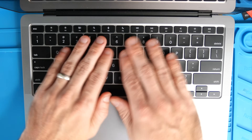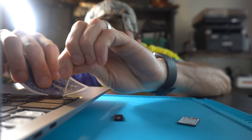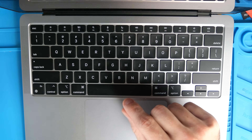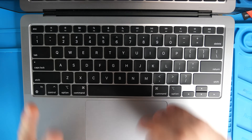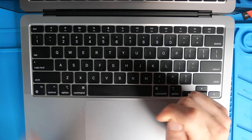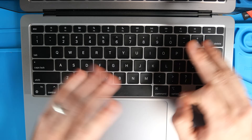Tip two: get down to eye level. You can't see it in this tutorial, but I'm getting my eyes down to see the key caps, to see where the plastic meets, and to get my toothpick in between to pry off the key cap correctly. Tip three: take your time and be patient — there are very fragile parts and you don't want to rush it. Tip four: watch this video all the way through; you can do it at 1.5x speed, but seeing how everything is done before you start is going to be helpful.